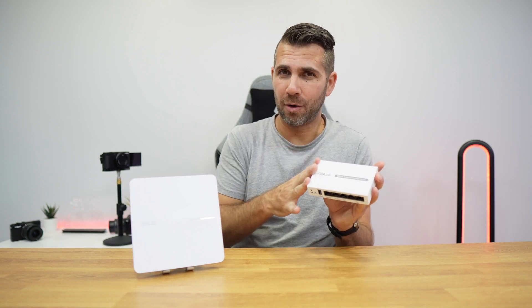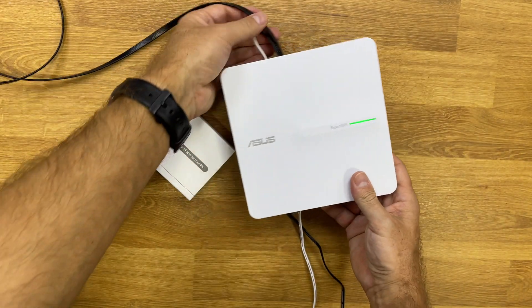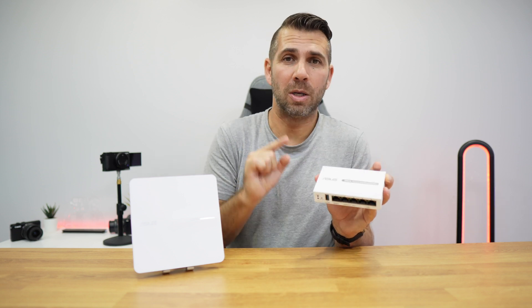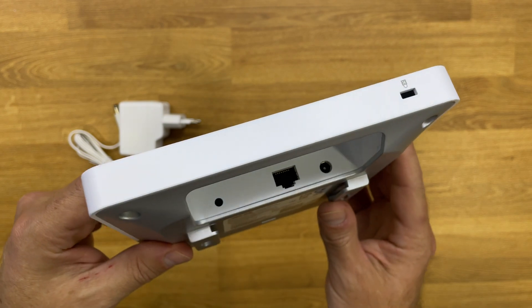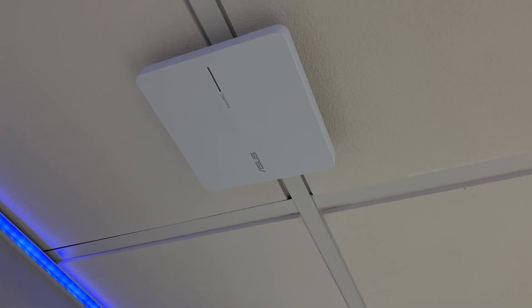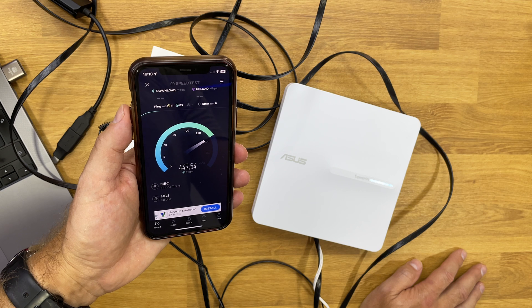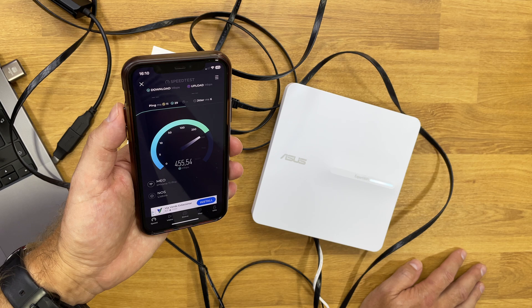The router doesn't have Wi-Fi on its own, but with the software we are able to manage the Wi-Fi connectivity on the access points connected to it, which is really cool. Looking at the access point, it's really simple — it only has two connections at the back: one for power input and one for the ethernet cable. I've connected both because this router does not have PoE. It's ready to be mounted on the ceiling, and I did it here in the office — really simple, no drilling needed, covering about 45 square meters without any issues.